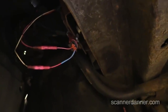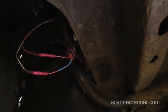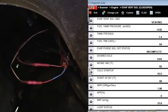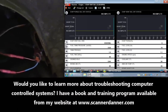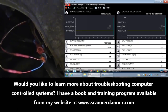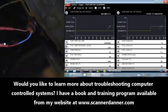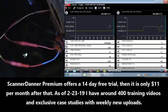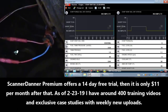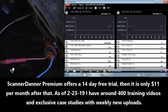All right, we're back in the car. Everything's all sealed up and we'll put some black conduit over this when we're done. What I'm going to do is just turn this valve on, which is to close it — we should hear a click. I'm going to go back and forth on and off. I'll unplug the solenoid and we'll watch that go to open/short to ground. That's with the solenoid unplugged — you can see the computer monitors that all the time, whether or not it is energizing it. And that is plugged back in, and you see the signal on the scan tool change. So we're good — that's it. Open wire on an EVAP vent solenoid. Make sure you guys are checking for that. If you find the solenoid is good, that would be your next most likely thing — a broken wire right near the connector.